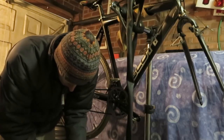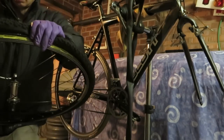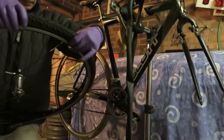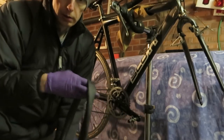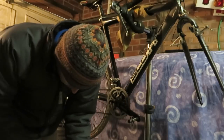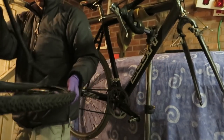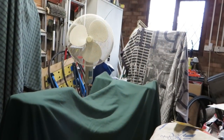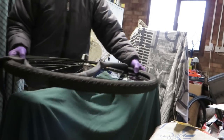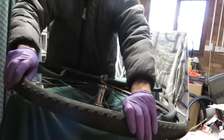Different tube, it's a spare tube. Put that over. Find the valve hole. Take the valve cover off. Cap. Drop it in. I'm going to try and do this to see what I'm doing. Rest it on the saddle. Now I've got to move you, I think, so you can see better. Just come through here so you can see me here. So balance the wheel, stick the valve in, drop the tube in, run it round, drop it into the tyre.